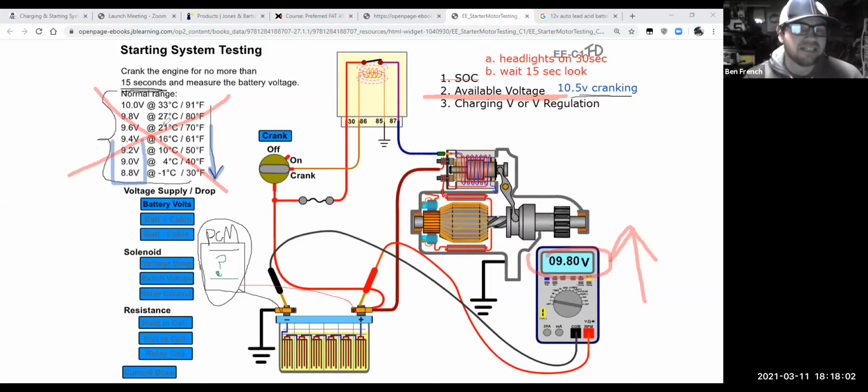So that being said, let's say we have a car that's hard to start. I hook up my voltmeter. I'm getting 9.8 volts. It does crank over, but maybe a little slowly. So I've got a slow crank, it's hard to start, and it's down to 9.8 volts. Then we have to ask ourselves, what would cause that? I think last week I told you guys my Cadillac story. You end up with a couple scenarios. Either the battery does not have enough capacity.